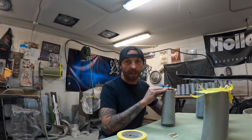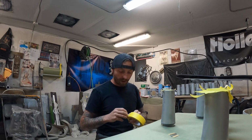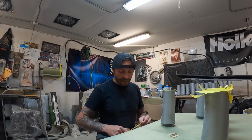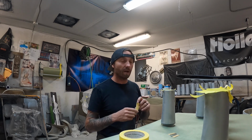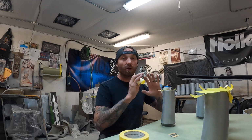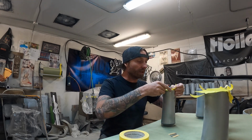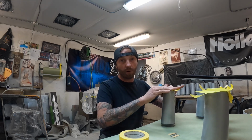Everybody thinks single stage is easier because it's paint and clear in one shot and you just put it on and Bob's your uncle. Well, if there's a metallic or a pearl in a single stage, it has to lay out, because if it doesn't, you can't correct it. You can't cut or polish it. With a two-part, the base is buried under that clear coat, so you can correct the clear coat. So it's actually more forgiving to do a two-part job than a one-part deal.